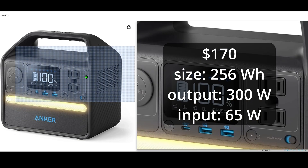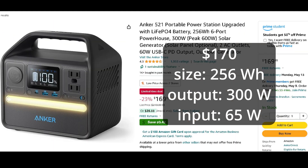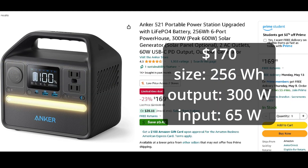This battery only accepts 65 watts input to charge it, which is not a lot. It will be enough to continuously power accessories like refrigerators, laptops, and small stuff. But the problem comes in with the underglow — the underglow alone will continuously pull about 100 watts at max, meaning we'll drain the battery faster than it can charge itself. Don't worry though, because with a total of 256 watt-hours, we can power the underglow for about 3 hours. Over 2 hours it gains back about 120 watts, allowing you to ride around with underglow for 3 hours, but after that it'll be dead. If you don't want to run underglow but do want to run interior lights, a refrigerator, and other small appliances, you'll be totally fine.